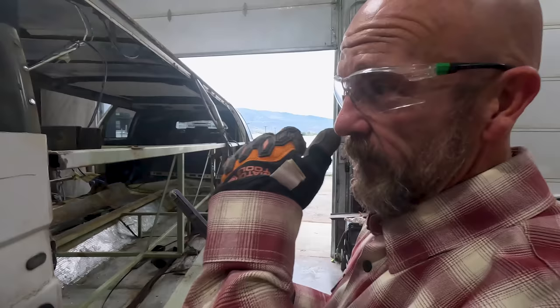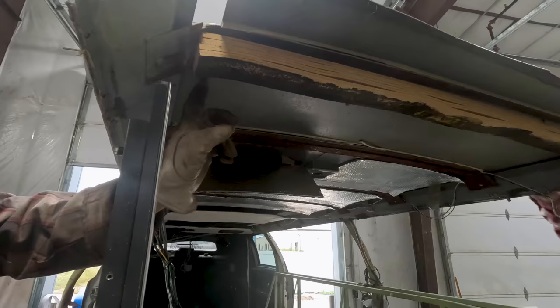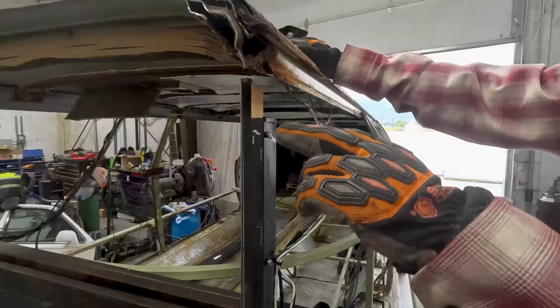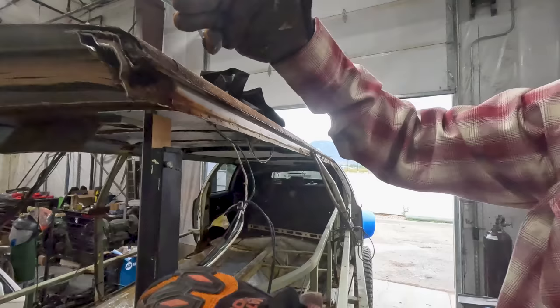Just got this side rough cut. We're going to for sure take this roof panel back behind this brace. I think what I'm going to work on now is just kind of trimming it back a little, getting it into there, and we'll get both sides exposed. That side's rusty as heck so we for sure have to cut it back. Right here is where it was rotted and buckling on the driver's side, back behind the pillars. So we're going to cut the skin back, open it up behind the brace and see how far we've got to go back and section in from the donor car.